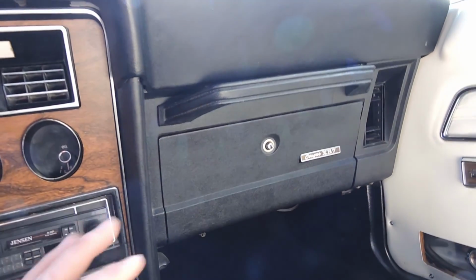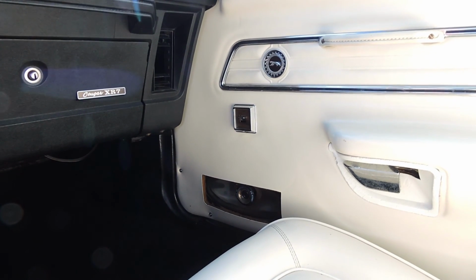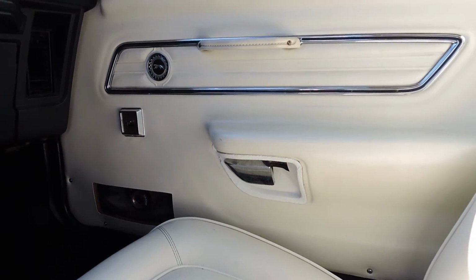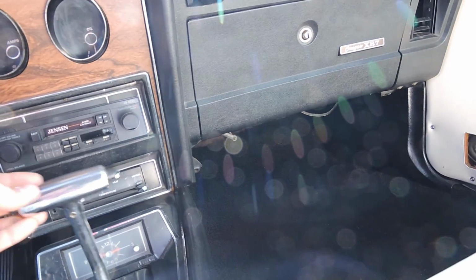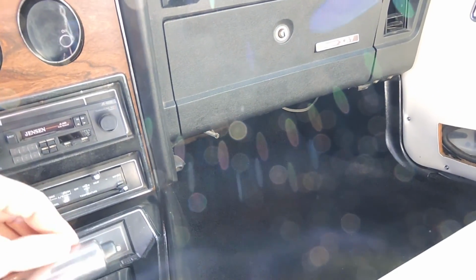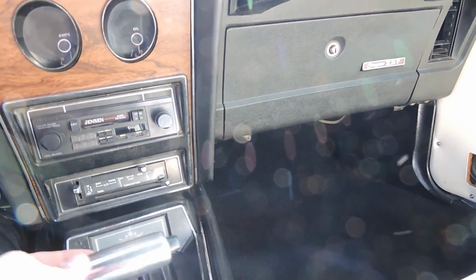The only thing on the interior, like I said, that needs done on the car is it needs a speaker cover, it needs the grab handles re-dyed, and those plastic pieces that the door handles go around should be re-dyed the right color. One other thing is the shifter itself. It works fine. It's just those bearings in that shifter. Probably needs the shifter replaced. It's about 30 bucks for the shifter. It's just worn out, needs a bushing in it.